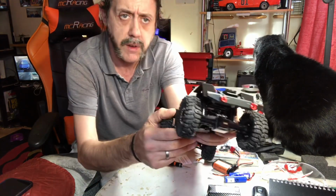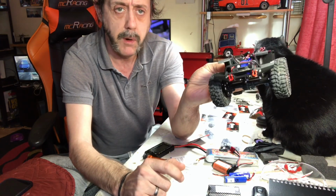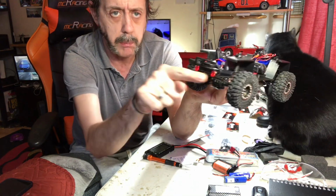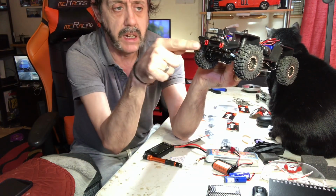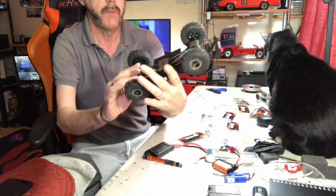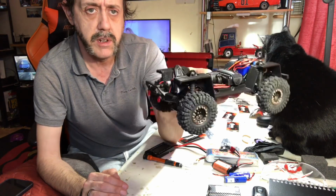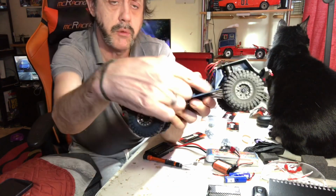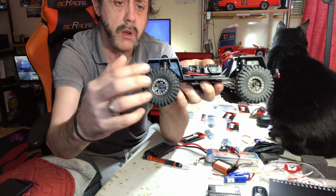And then also in this lot come with the D shackles. Fitted them on Friday, but what I had to do to make them fit was to drill the holes in the bumper bigger, because it was such a tight fit that you couldn't really get it through straight to screw into the other side of the shackle. Also, since last time I've had the 3D printed inner arches fitted, that caused a bit of a problem fitting them. We had to countersink the screw holes so I could use the original screws rather than using longer ones.